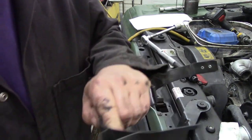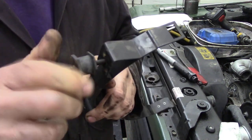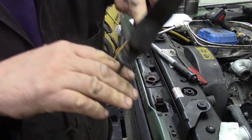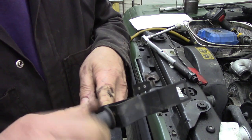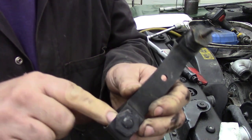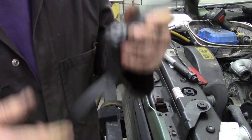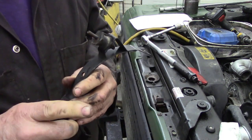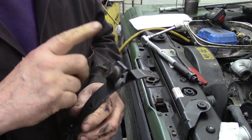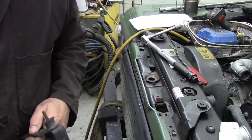Just as a little tip, you probably already know this, but when it comes to replacing these rubbers here, you have to put them into this bracket first and tighten them down before you put them into the main bracket. Alright? See, so wind those down, give them a nip up, and like I say, because it's got a welded captive nut in there, you see what I mean? Otherwise you can only do it that way around, and that's why it's easier to take the bracket off. But if you've got to replace them on the car, on the 300 TDI, it's not wise to take that bracket off, because you'll disturb the head a little bit. Can't win, can you? Daft idea, but there we go.